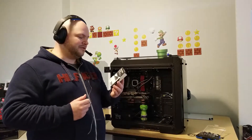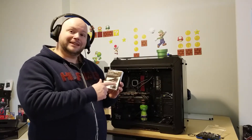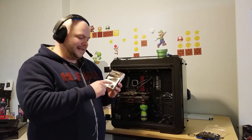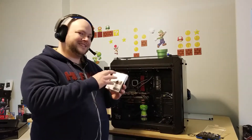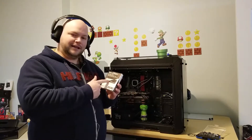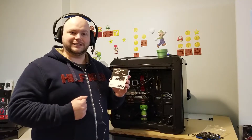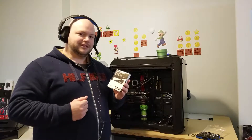Before we start you're going to need a few things. Obviously you need an M.2 drive — M.2 refers to the type of socket the drive uses to connect to your motherboard. There are different speed ratings and controllers: the SATA controller, and PCI Express which comes in a few different varieties. The fastest is the x4, which uses four PCI Express lanes to transmit and receive data. There's also an x2 which would be slower than x4 but faster than SATA.